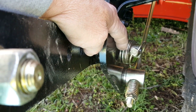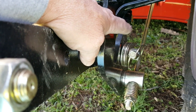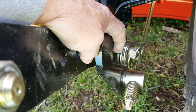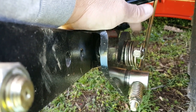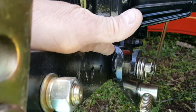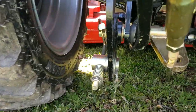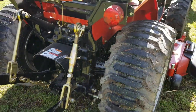I had to go back in and get a couple of washers - I wanted to put a couple of washers in there. I don't know if that was the way it was supposed to be. They originally came with, I think, one washer. It doesn't seem like it has too much of a difference whether it was one washer or four. Like I said, the bracket goes on here. When you lift the back, it actually pulls on these springs. And you've got one on this side here too that does the exact same thing. That's how you lift your deck up.